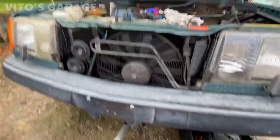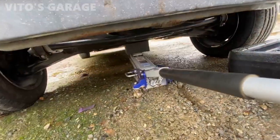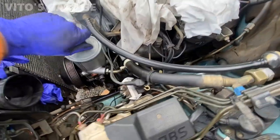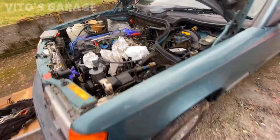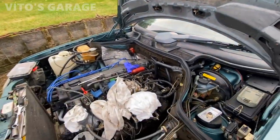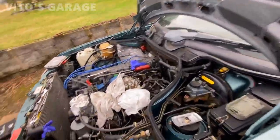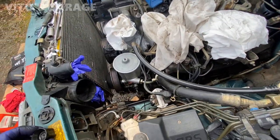I'll be jacking it up now — front wheels. There are different ways of getting a power steering flush done. That hose right there is disconnected on this side. What I'm going to do is add more fluid. I have it jacked up on both sides, both wheels. I'm going to turn the steering wheel — like I said, there are many different ways to do the power steering flush, but this time I'm going to do it like this with both wheels off the ground, engine off, turning it one way and the other so the fluid starts coming out. Then I'll constantly keep topping it up.